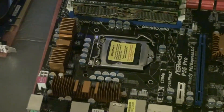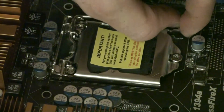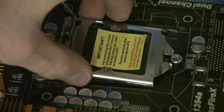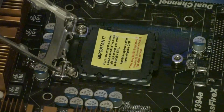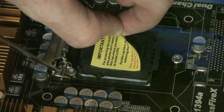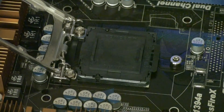Be extremely careful with this step that you don't bend any pins or crush anything. The processor has a zero-force insertion, which means you use no pressure to install the processor. Basically, if you put it in correctly and line it up with the pins, it will just fall into place. Then you simply push down the socket cover — the metal lever — to hold it in place permanently.